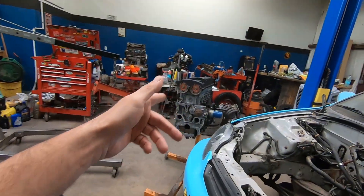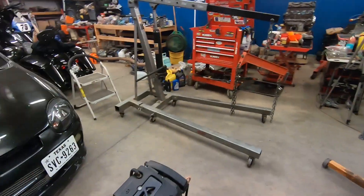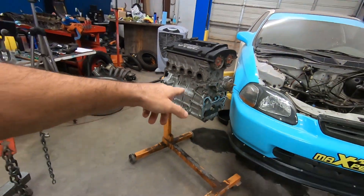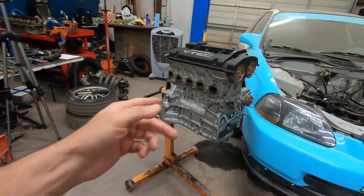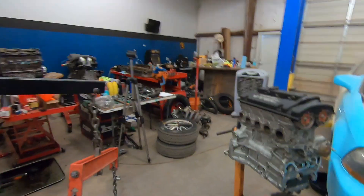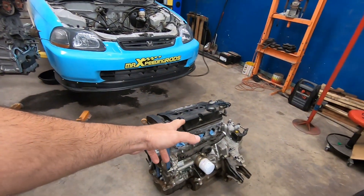I was led to believe that the counter shaft delete kit on this engine wasn't done properly, because I have one and I do believe that this kit came with plugs for the galleries that feed oil to the shafts, and I didn't see any when I took the engine apart. I think that's what happened with this engine - it had a very short life. Even the threads on the crank bolts still had anti-seize on them when I took them out, which tells me the engine didn't last very long. I think they spun it up to 10,000 RPM without proper oil pressure, bleeding pressure through the counter shaft holes, which burned that bearing up.